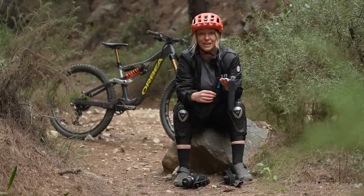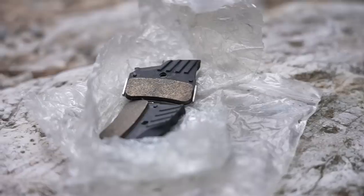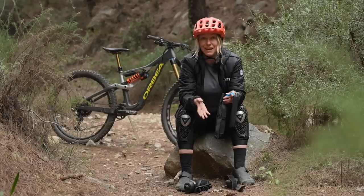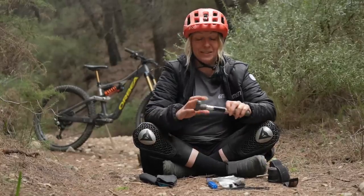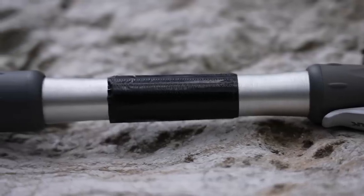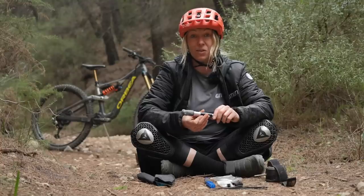This is everything I keep in my down tube. It seems like a lot, but actually all of these spares don't weigh that much, so it's always worth bringing them. Things like spare pads just in case anything goes wrong with the ones you've got in — you may make it to the bottom of a race stage, but you'll need to replace them between stages to keep going for an all-day ride. I also put gaffer tape on my pumps. It doesn't weigh anything, doesn't get in the way, but it could be super useful for fixing broken waterproofs, attaching things to the bike — I've actually fixed a split sidewall with it before. You can also double it over to make a tire boot.